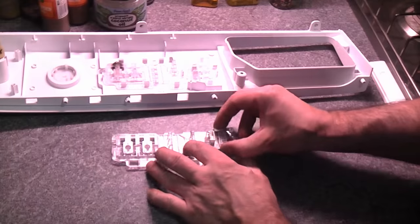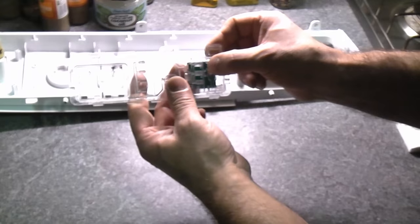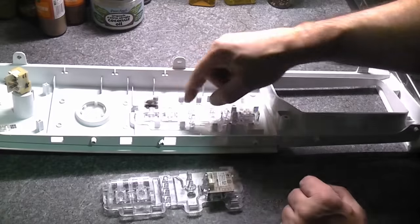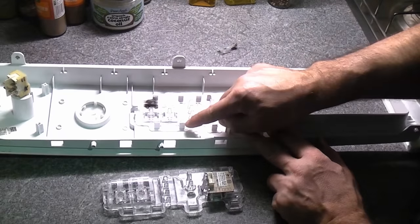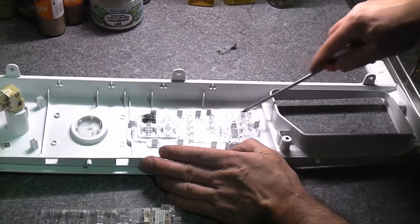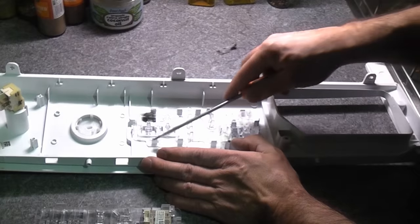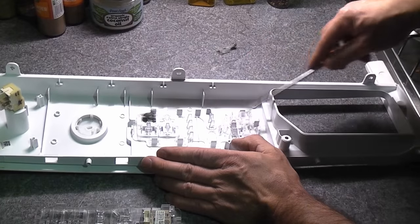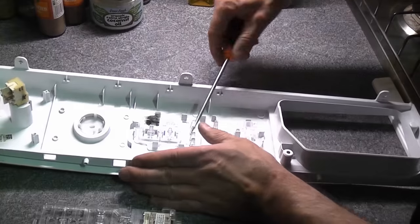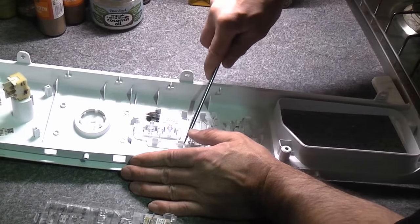To start, remove this small circuit board which has two plastic tabs that need pushing back, then carefully lift it out. Push it back in and check it's working correctly — when you press that part you should hear the switch clicking. We now just need to remove the rest of the light guide. Because we're replacing the light guide, I'm going to ensure that if anything breaks, I break the light guide and not the plastic pieces fixed to the panel, since it doesn't matter if we break it.